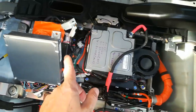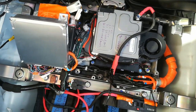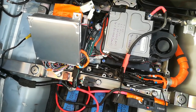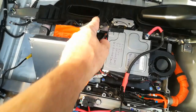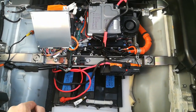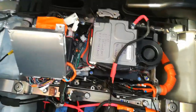Because we've doubled the voltage, the speed that the voltage ramps up is about twice as fast as it's expecting, so it's probably not calibrating correctly. I'll need to look at the bypass resistor and check if I can manipulate that — if you remember, I doubled the value of that in the other setup to remove the battery current sensor error. So basically I've got to take it all out again and get it on the bench, and we'll see if the extra resistor on the pre-charge resistor fixes the battery current sensor issue.